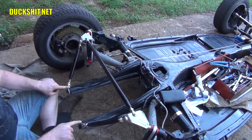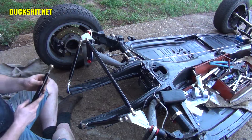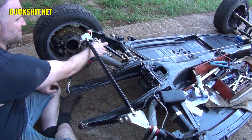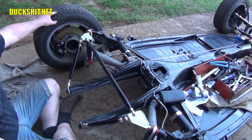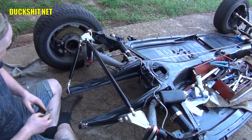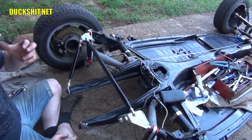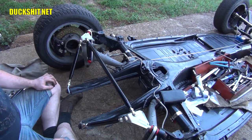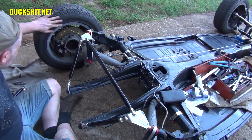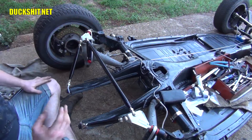This is how the four-point brace looks — they attach here, here, and one all the way across. That's really all there is to it for a four-leg system. Because we're going with the six-point, it's going to run down into here like this. What I'm going to have to do is jack up the rear end. At the same time I'm going to take these tires and reverse them, because about a year ago when I put this chassis together I actually put the wheels on the wrong side. Even just last week I had both wheels off at the same time and just failed miserably at swapping them back. In order to do it properly, I'm going to take these off and put them back on so nobody calls me out about it anymore.